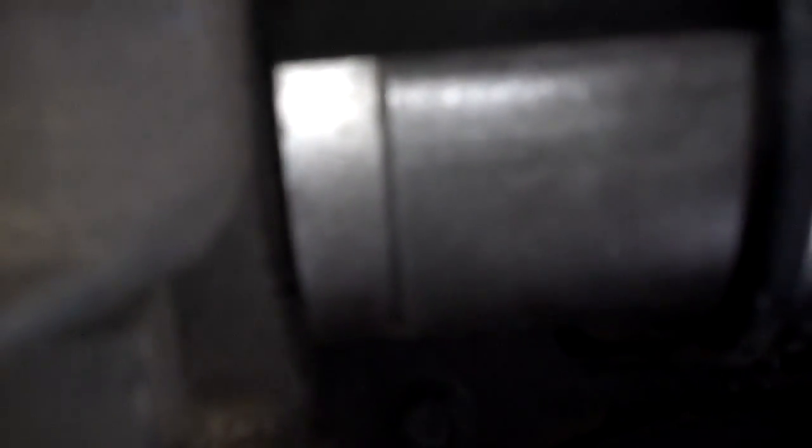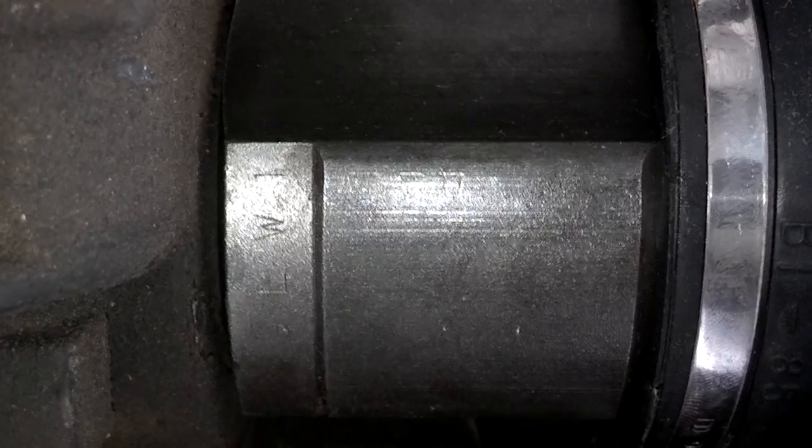It felt like it clicked. I'm going to try to pull it out softly to make sure it doesn't come out with just a minor tug. I need that to pop in there better — evidently the clip didn't seat. So I'm going to pop that in so the clip seats, because I don't want that coming out. If it comes out it's going to shut the car down — it'll act like the transmission is locked up. Try to get it all the way in so that the clip ring snaps in.